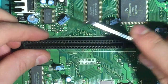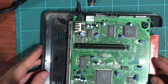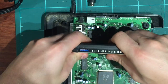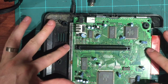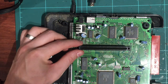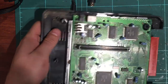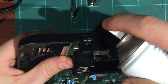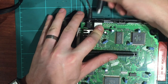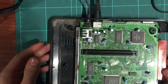Do it on both sides, give it a clean, and you're all set. I'll turn the board around and do the other side. I've put the board back in the tray for support underneath the cart slot while I put the cartridge in and out a few times - you really don't want to crack the board doing that. I've reflowed the solder points, reflowed the multi-out connector points, tensioned all the cart pins, and cleaned them with contact cleaner. I'll also clean inside the multi-out - that could be it as well, maybe it's just dirty inside.